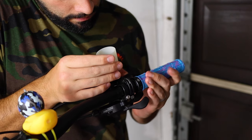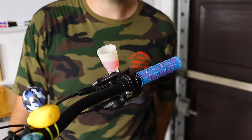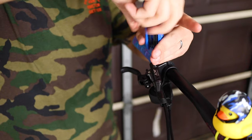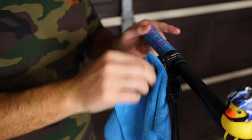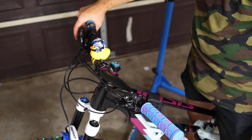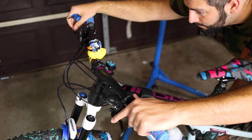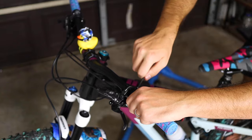You'll head back over to the lever, tap the lever blade just like we do for the easy bleed, and get any remaining bubbles out. Seal up the system, clean off your levers, and it's done. So there you have it — you've completely fixed your brakes. But since we've kind of torn everything up, you'll have to take some time to readjust the positions of all of your cockpit — get your levers in place, your grips in place, your shifter, and then you're good to go.